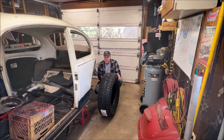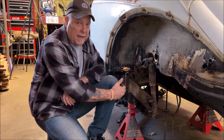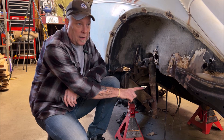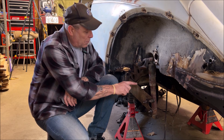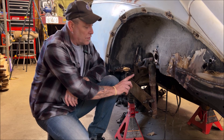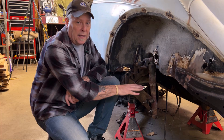The IRS sometimes works a little bit differently — the inner and outer are pretty much clocked differently. A lot of folks will pull the cap off, pull the arm out — remember, there's a lot of tension on this — and there are many videos online if you need it right away. You just want to move this one notch, but mark it before you do that so that if you want to go back to factory height, you can. Then you're going to move it up one notch — up in the air — and that will drop the car down.